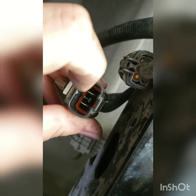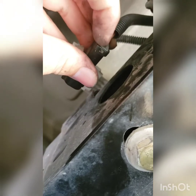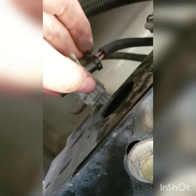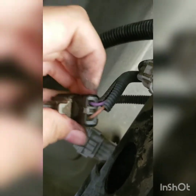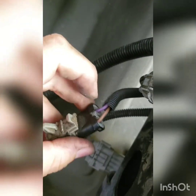With this connector, in between the tab and that orange piece deep down there's a tab you're going to push on. After you remove the retaining clip, you're not going to push it through — you're going to stick a small flathead through here and pop it up, same on the other side. You can see it's like an M-shape; the bottom of the feet are facing this end, so you pop that out and use a pick.